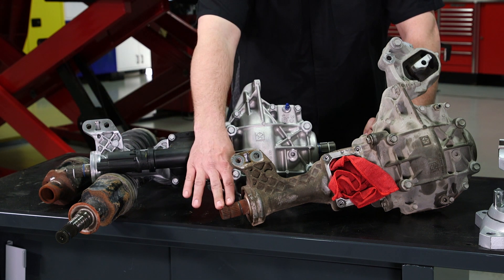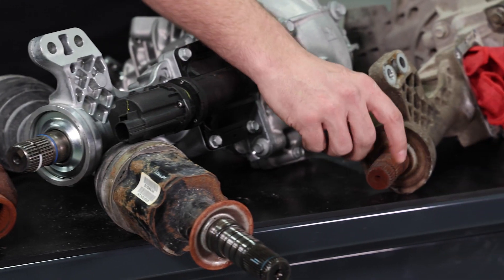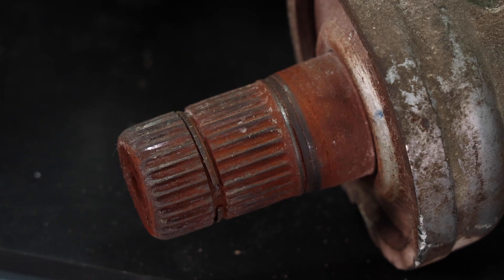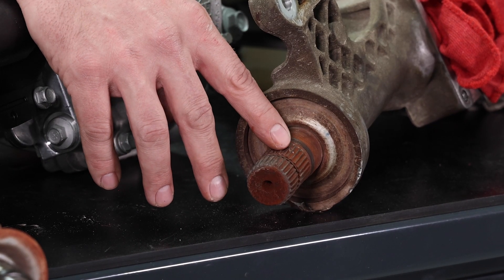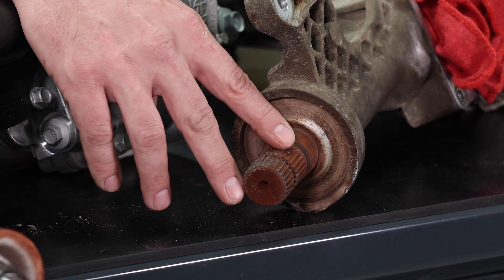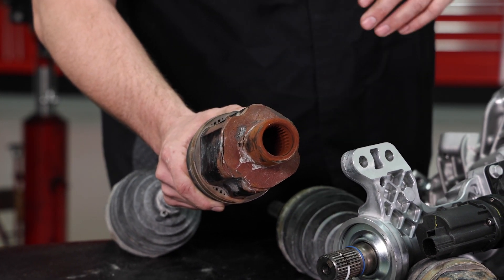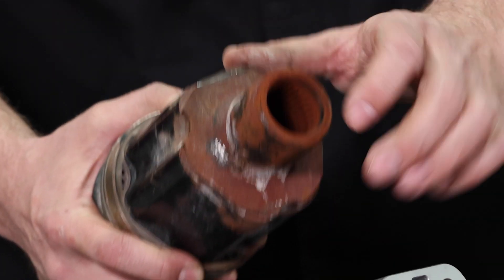The main points are the difference in these stub shafts. On the new one you can see a nice pronounced o-ring and the spring retention clip. On the old one the o-ring is fairly worn away — completely degraded — and the spring clip has no retainment. This o-ring failed at three years old and 90,000 miles, allowing water, dirt, grime, and salt in, which destroyed the spring clip, created rust inside the shaft, and caused rust jacking that pushed the shaft off and allowed it to move around. You can see witness marks where it was just bouncing up and down.